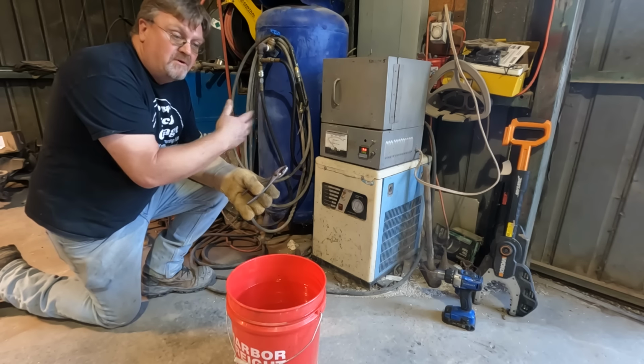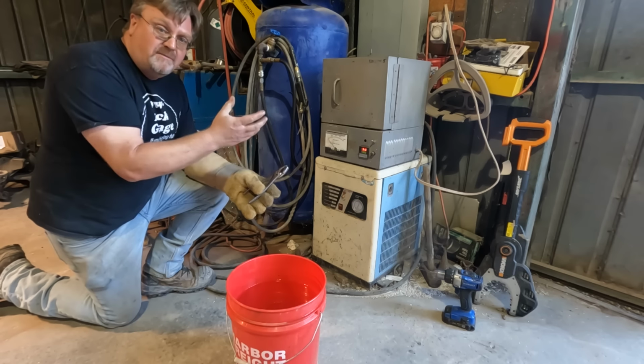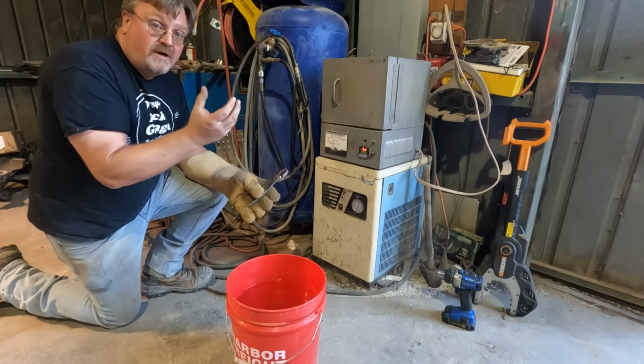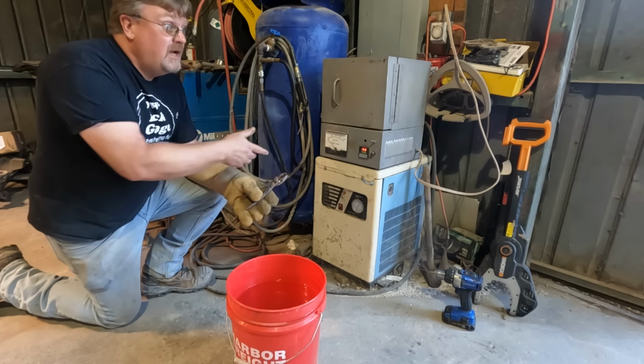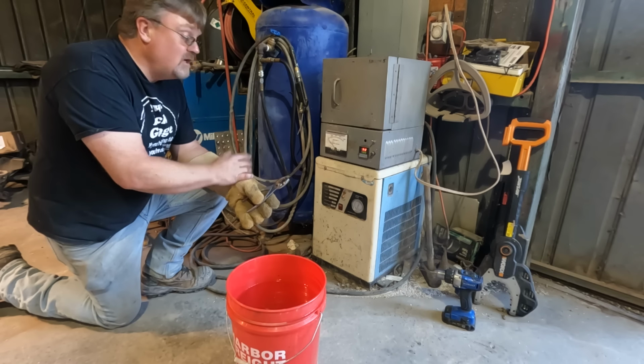There's some minimum number of minutes you're supposed to do, but basically what you want is the aluminum to be heated thoroughly and have a little bit of time for the molecules to bounce around and reorganize somewhat. If you actually want to do it right, you read the spec. I ignored this and worked on bleeding my brakes, and I figured that's long enough. So we're going to pop it out.